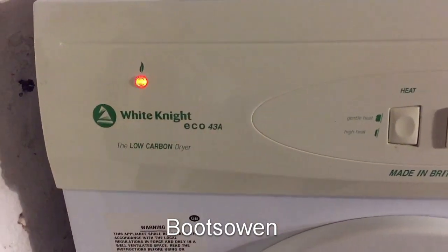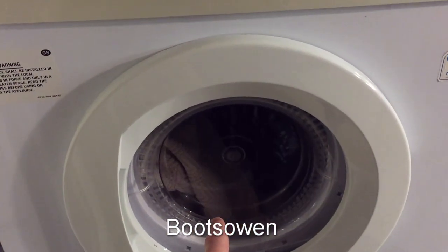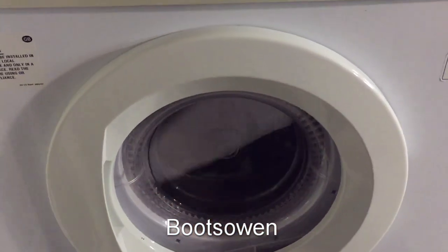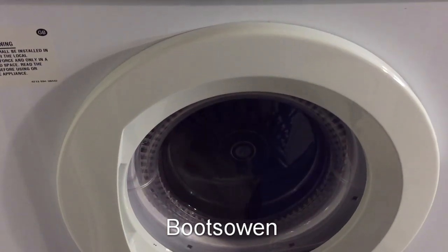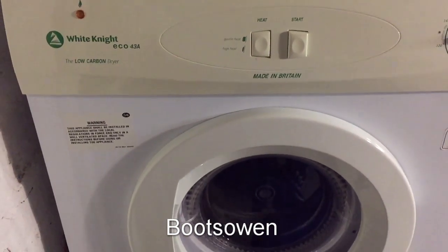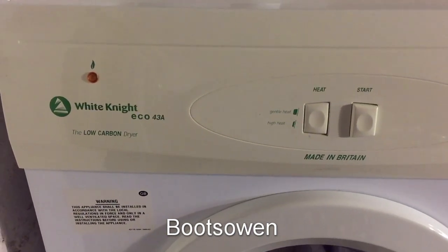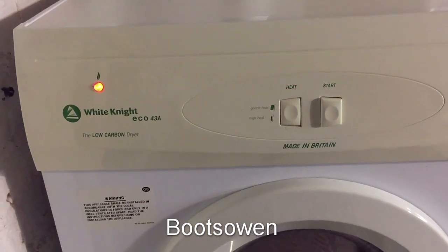There's that indicator light on — it appears to flicker on the camera. Now it's stopped; it does a reverse for 10 seconds. So it's reversing now. At this point it should be using less than one amp or around one amp. There it stops again — it should start going clockwise and then the light should ignite again. Should ignite — it might be hot enough already. There it is. It's off again — the blue flame, a couple of flickers. It's just a single jet coming in from the right-hand side.